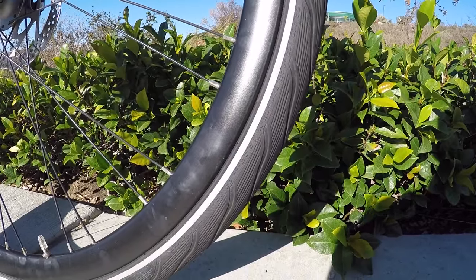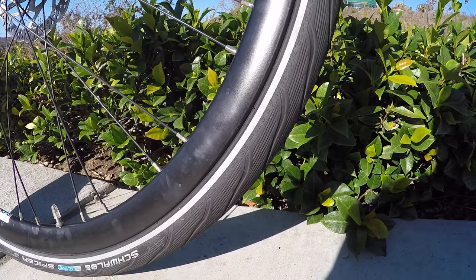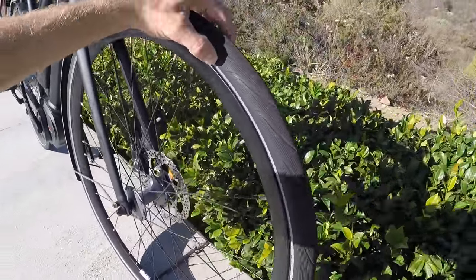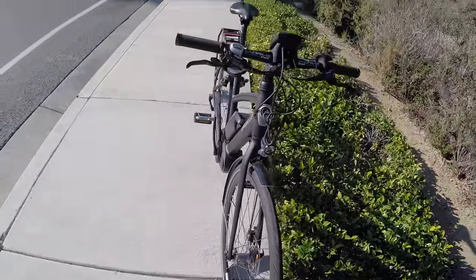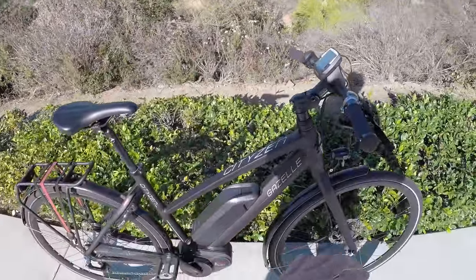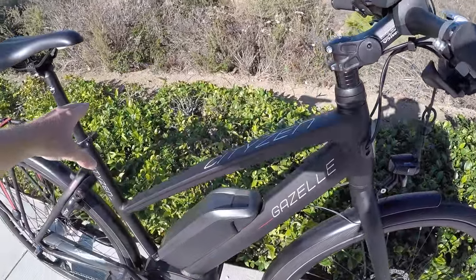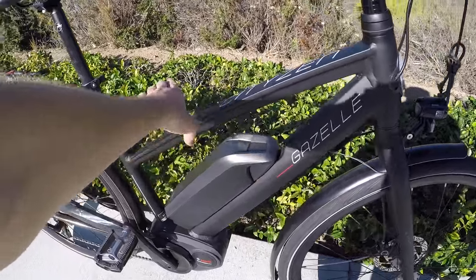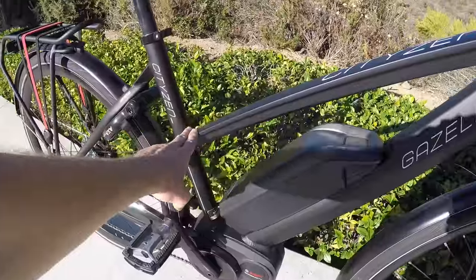They're a little bit narrower, rated 65 to 95 PSI, which is really quite high — definitely harder. Very smooth surface, so it's designed to coast, be smooth and nimble. This is a more active bike. The frame style they call the trapez — I call it mid-step, because you've got a traditional diamond that's really high where you have to swing your leg over. This one is about 27-28 inches standover.